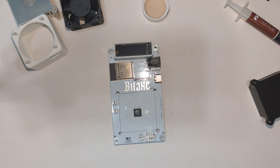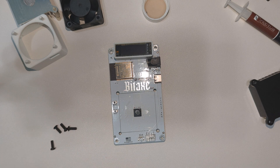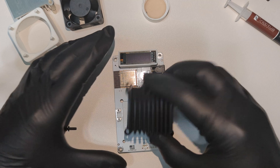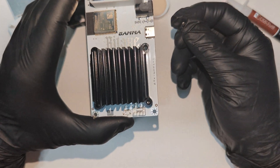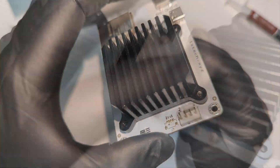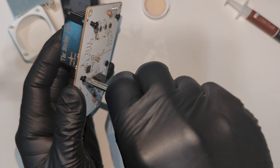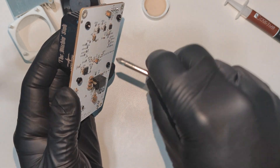Next, I'll locate the screws. These screws will go in through the back of the circuit board and attach the heatsink. It does not have safety stops, so you need to make sure you tighten this down with extreme caution — it should not tighten all the way. I'm going to place the heatsink directly on top and make sure the holes are aligned. I found this also works better if you flip it upside down and place the board on top of the heatsink. That way you can directly put the screws in and start to tighten them down. Finish screwing in the heatsink, being careful to screw them in evenly and just until they touch the board. Once you have each screw just touching the board, give each one a quarter to a half turn to help compress it down a little bit more.